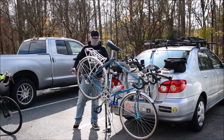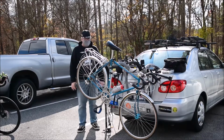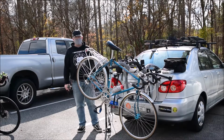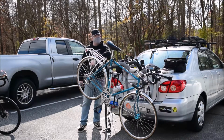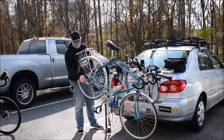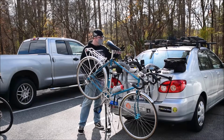Filling out what's going on, what's wrong with your bike, you just want to make sure that none of the bearings feel rough. You want to change your chains every 1,500 miles, about 3 to 4 months. You want to take it into your local bike shop and have one of the little chain checking tools. Pop it on several different lengths on the chain. See if it slips down in there. If it does, go ahead and change it, and see if you can get away with just doing that with the chain. If it skips, then you've got to change the cassette.